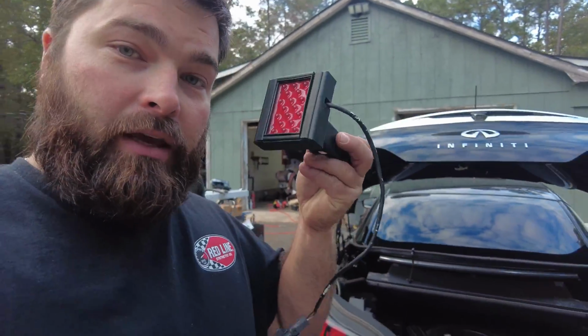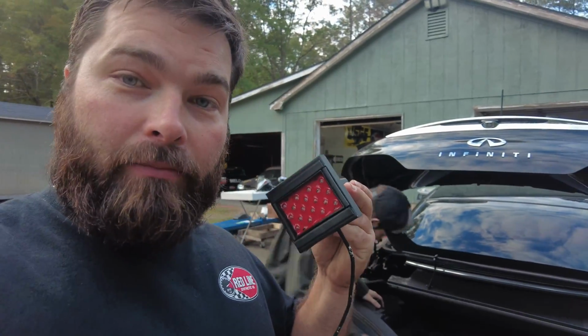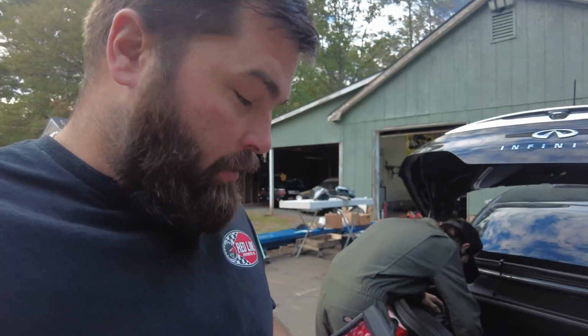All right, so the first thing we're going to start with is the, I would say third brake light, but the fourth brake light, the racing rain light. Now this light can be wired where it goes straight to a solid red light for like your brake light or your running light, or it can do a blinky strobe light, which in our state is illegal. So we're just going to make it the solid one, working with the brake light as a fourth brake light.